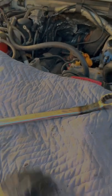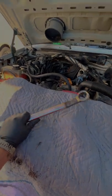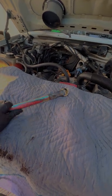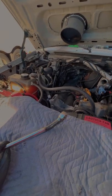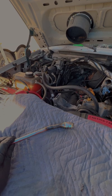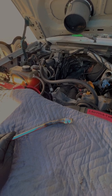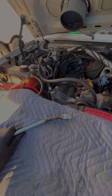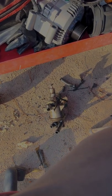I got the lines off. Here I have my custom 7.3 fuel pump wrench — anybody who's ever done one knows what this is all about. There's a banjo bolt on the back of the pump almost directly underneath the turbo, and with this bend you can get it off without pulling the turbo. That's what I was saying — if I had to take the turbo off to get the lines off the heads I'd just do that, but I don't have to. Victory!